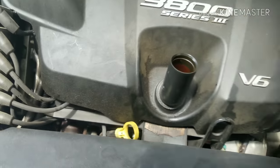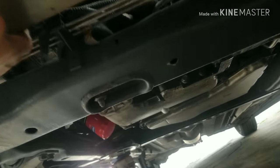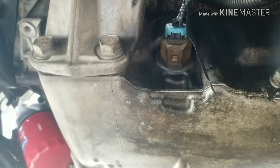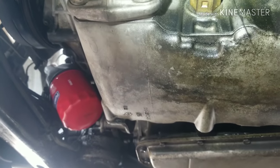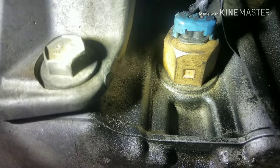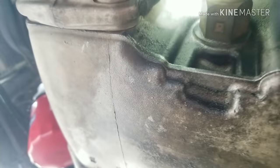After checking the oil level, the next thing you want to check is the oil pressure sensor, which is located under the car. You can come under the car and see the sensor here. They are in various places depending on the type of car — on this particular car it's right here. Sometimes you'll see oil seeping out of it, drips or drops of oil. Sometimes you can just look at it and tell that's your problem. What it does is sense the pressure in your oil.